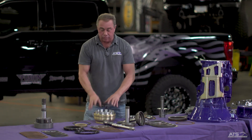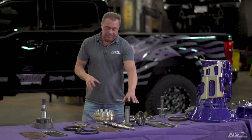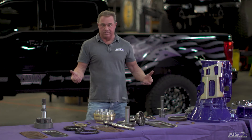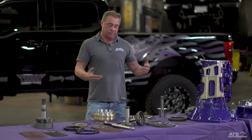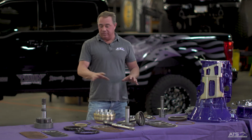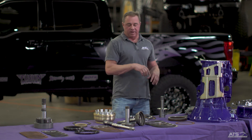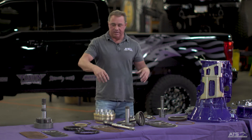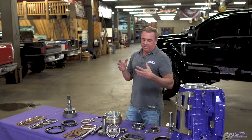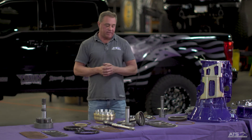I don't ever recommend the 68RFE for over 800 horsepower — it holds really well up to about 800 hp, but you're still limited to the size of everything. It's not like an Allison transmission, which is just bigger in every way and inherently holds more power. But the 68RFE does really, really well when everything's redesigned. You have the case modifications, pan, all the hydraulic and valve body modifications, hard part modifications, all the clutch packs — combine all that together and control it with a nice electronics package, and for a small transmission behind a huge motor it does really, really well.